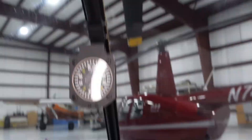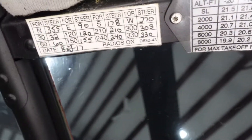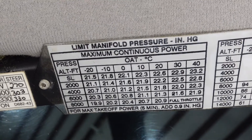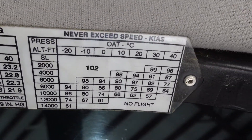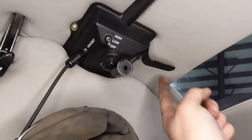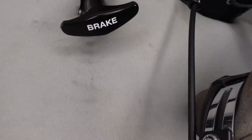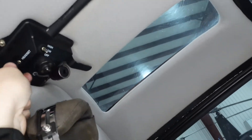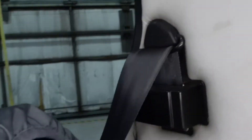There's our compass. Up above the pilot seat we've got a couple of different charts: a magnetic deviation chart, a manifold pressure chart showing how much engine power we can pull, and our never-exceed speed chart showing how fast we're supposed to fly at different weight configurations — that's called V-NE. The left-hand pilot has a sight picture or glass window above him. We've got somewhere to hang our headset and a rotor brake — when shutting the engine down we gently pull that brake down to stop the blades.